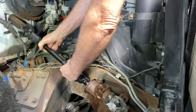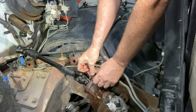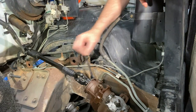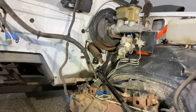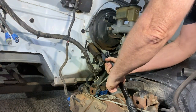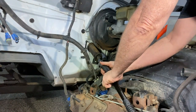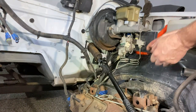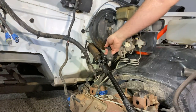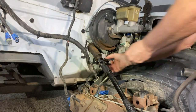It fits down like that. Slip that bolt in — the bolt goes right in. Now we're going to attach the upper portion of the steering shaft. It compresses a bit and slips right over. Now I'm putting this bolt through there, and with that bolt tightened, run the second bolt through for added security.